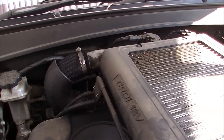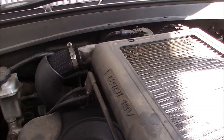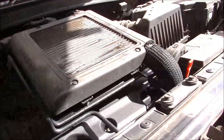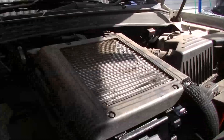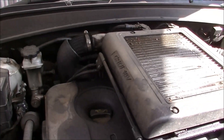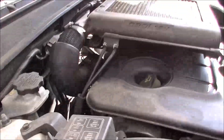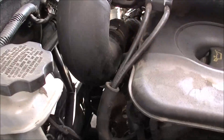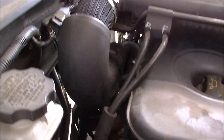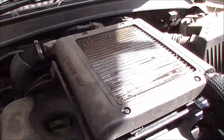We knew the EGR had been filthy, it was cleaned up, and we replaced that EGR quite a while ago. Now it's coming up with an EGR temperature issue. I put a radiator in it a few weeks ago because it was leaking, and we thought that might have been the issue, but it's not. Now we've noticed it was leaking something down the back of the engine.